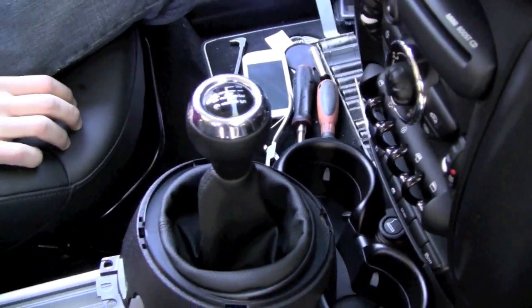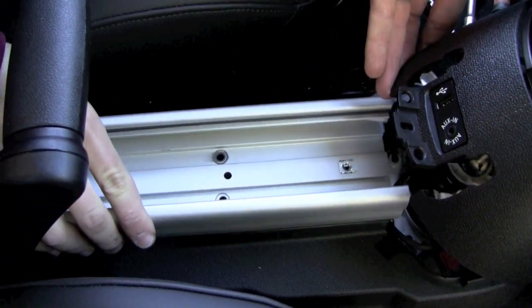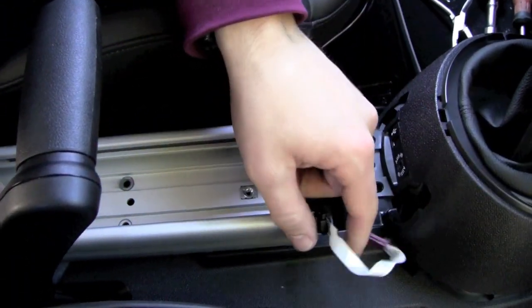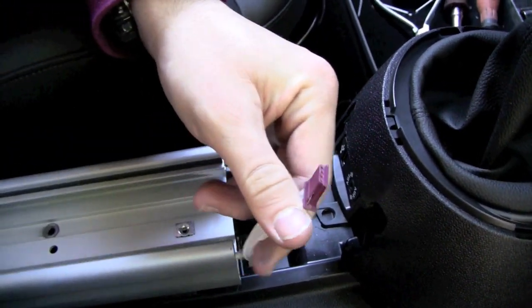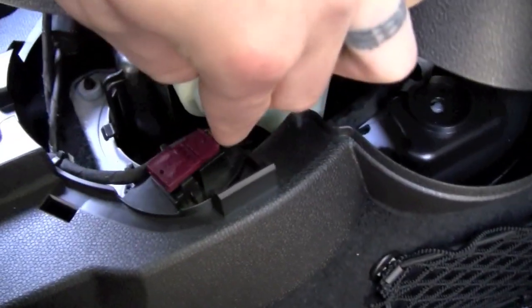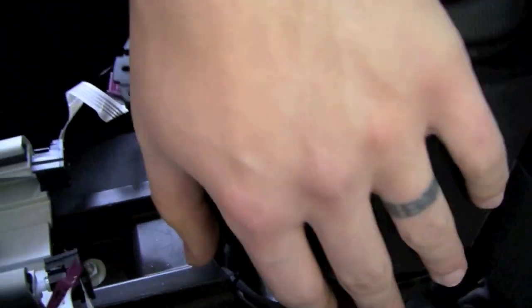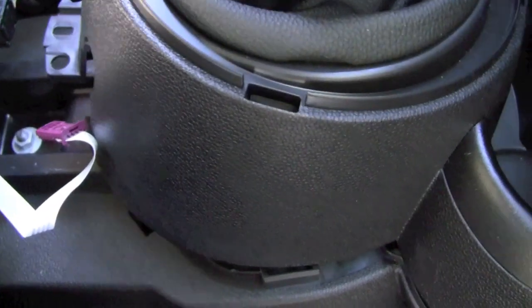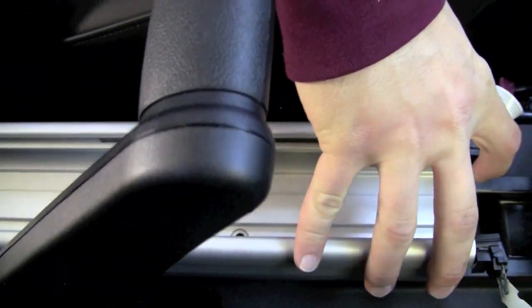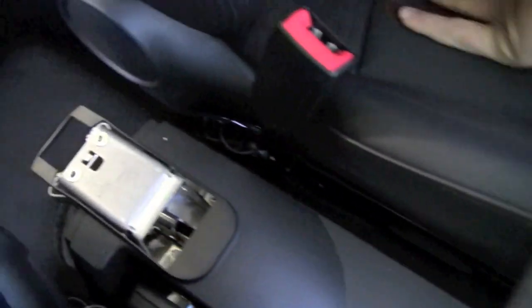You don't need to remove your shifter knob. That gives you just enough room to remove the rail. You'll notice these are the fiber optic electrical lines connected underneath — they've got the requisite female and male connectors. Be very careful with those. It's a flat wire type system, but there is a fiber optic light that goes all the way down the center of the rails on either side. So you want to be careful to remove that, and once it's out of the way we can work on the bracket back here.